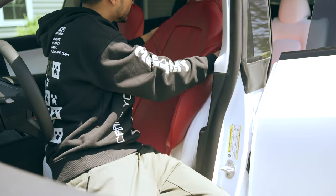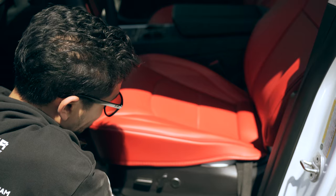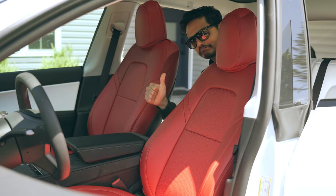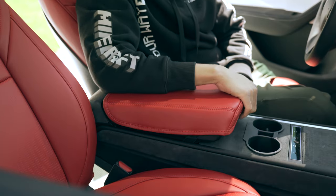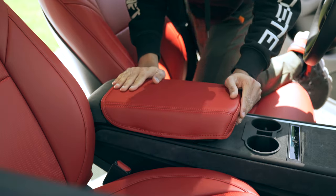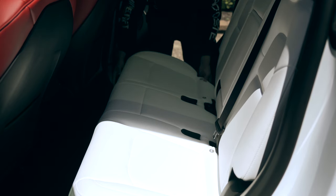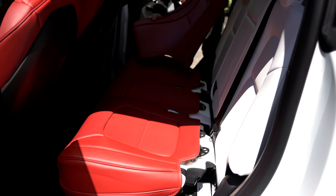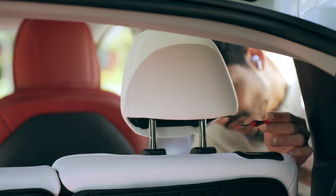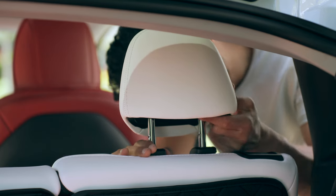Repeat the same setup for the driver's seat. You also receive an armrest cover, but I'm not a big fan of its fit — personally I prefer the black and red contrast without the cover. The back seats are a bit trickier. First, pull out the bottom half and slide in the cover. Before installing the seat back, install the backrest covers, but before that, remove the headrest. Use a thin, sharp tool to reach the tiny button at the base of the right post to release the headrest.